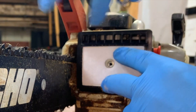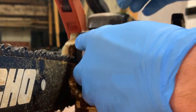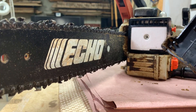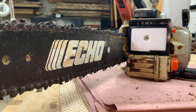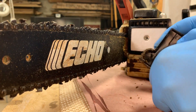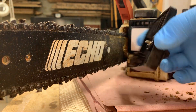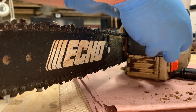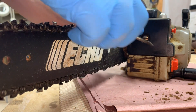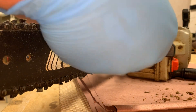There's only one way this air filter can go on — the vent holes go to the top. There is a little lip that goes in, so I'm going to push this in. This cover has a lot of nastiness on it, so I'm going to knock off what I can and then use a blue towel to make sure there's no debris on the inside. The last thing you want to do is mess up your brand new air filter. You're not going to feel it snap into place, because as you tighten down the screw it pulls itself in. Get that nice and snug — you don't have to overly tighten it.